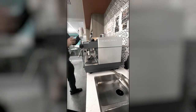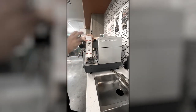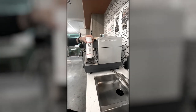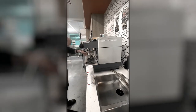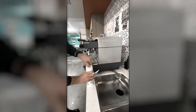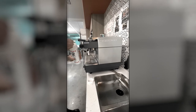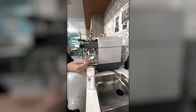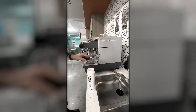And we use this Espresso Parts scouring powder. And by the way, there are several spare ones of these in the boxes below the table inside the coffee vault room. And we basically take our back flush unit and we put in, I would say, about 2/3 of that amount. Not full, not heaping, maybe about 2/3 there, so you get about that much material into the unit.